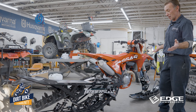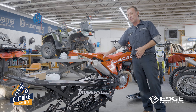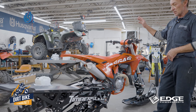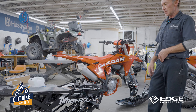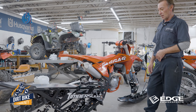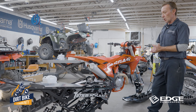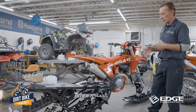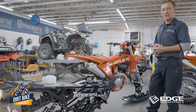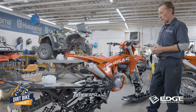Something to keep the dust off your bikes during the wintertime — go out and enjoy it. I would definitely recommend going with the 450cc class. These will mount up to any motorcycle out there — the KTMs, the Huskies, the Gas Gases in our market end of it — but you can run these on quite a few different units. If you go with something lower than the 450cc, they do rob a little bit of power up in the snow. That's a lot of track to be yanking around behind you, so we definitely recommend going with the 450s.